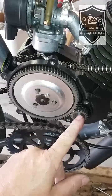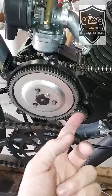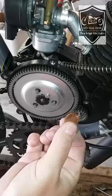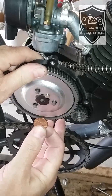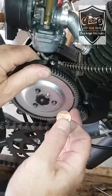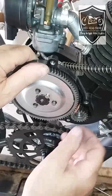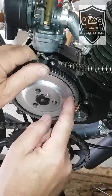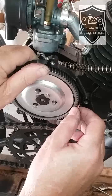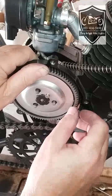Next thing you'll do is remove the bevel gear screw that holds on the bevel gear, and the lock washer that's on there as well. The easy way to do this is you use a penny — you always know these gears want to turn when you don't want them to. So when you're turning the screw out, you take a penny and jam it in there. It locks these into place without damaging your gear teeth. So if anything gets hurt it'll be the penny, and then you just turn your screw out and you're good to go.